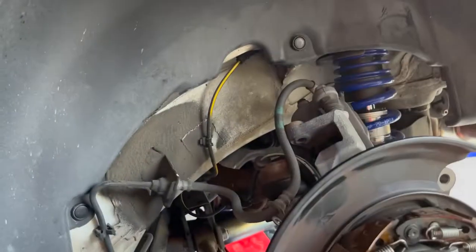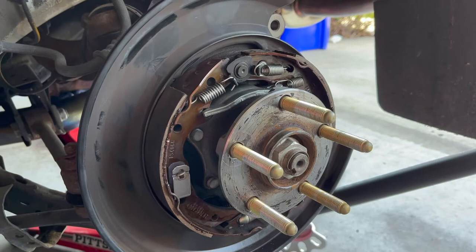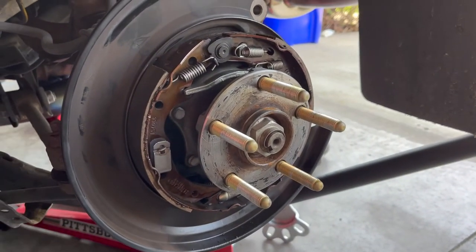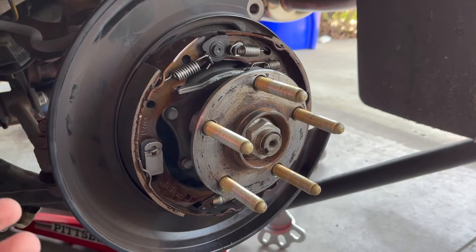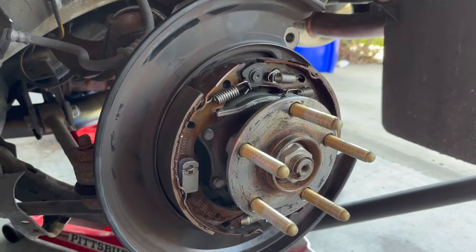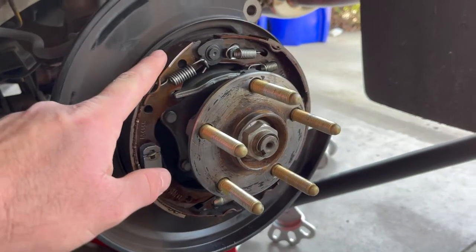We had to use a series of hammering, straight slot screwdrivers, and pry bars behind this face right here in order to pull it out far enough to get them in. It did eventually work. The back right side took way longer because it was a trial and error kind of thing of us learning. But this side only took us about an hour and a half after we learned the other side. Normally this should only take you like 30 to 45 minutes to do the whole thing, because it just shouldn't be corroded like that on newer cars. But this is an eight-year-old car that's lived its life in the Midwest. It helped us a lot by taking the e-brake assembly completely apart. With the e-brake assembly out of the way, we were able to get better access to wedge stuff down behind that face and help pull the hub out slightly. We used WD-40 - I wish I'd had some better penetrating oil - but really thankful that my neighbor Draven came down and helped. He brought some WD-40 and some extra mind power to bounce ideas off of, and having an extra set of hands really helped too.